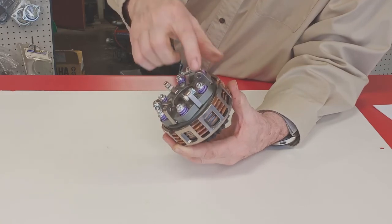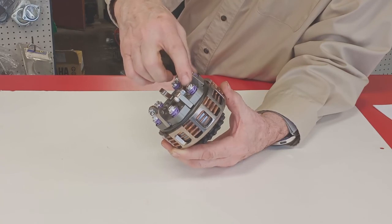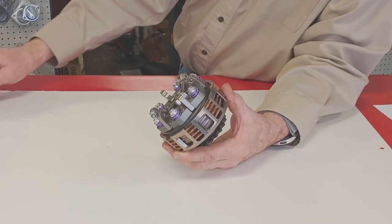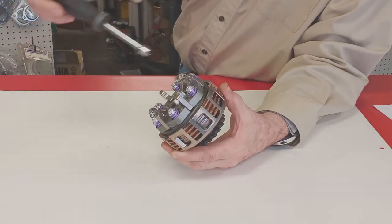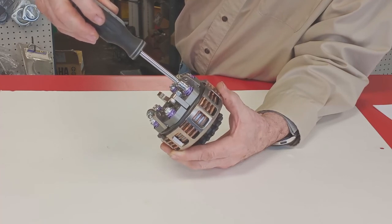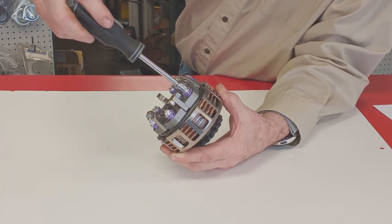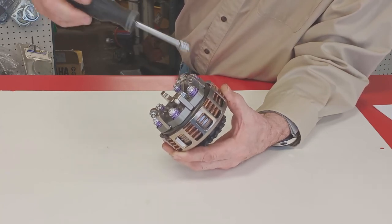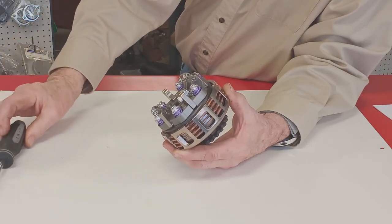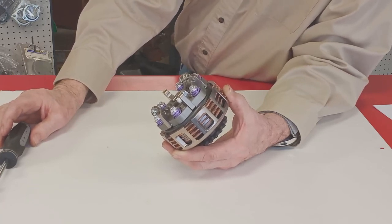Increasing the tension on the springs increases the RPM required for the weight levers to overcome that tension and squeeze the discs together. On the dry clutches, turning the screws on top of the springs clockwise increases the tension and so raises the speed at which the clutch engages. Turning them counterclockwise lowers the engagement speed. For the bully clutch, you'll use a nut driver with a 5/16 end. For the small diameter dry clutches, you'll use a hex key that's 1/8 of an inch.